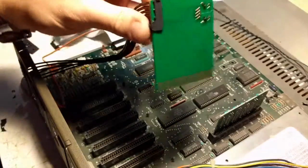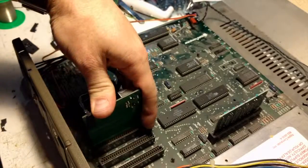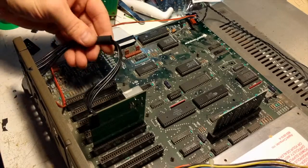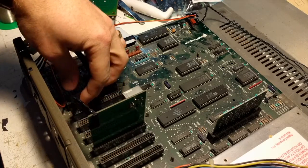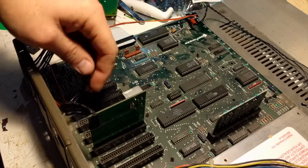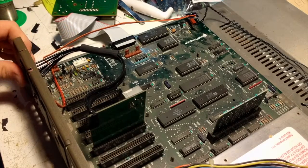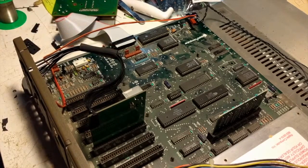With all that in place, pop your Ethernet card back into its slot. The light pipes should wind their way around anything else that you've got installed. They're fairly flexible, but they can be a little too stiff in some instances. A little bit of hot air from a hairdryer or from the lowest setting on a hot air gun will make them a little more pliable and flexible and easier for you to manipulate.